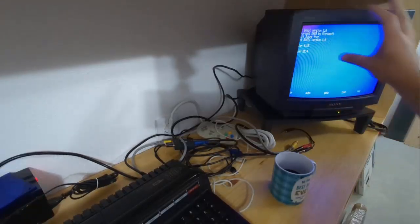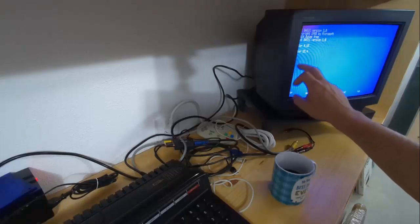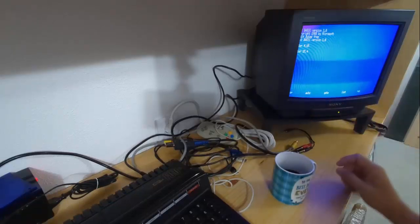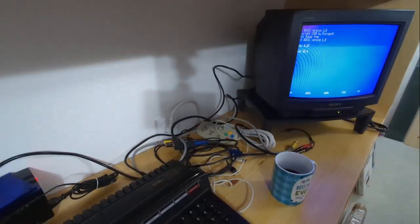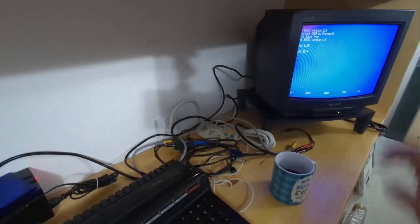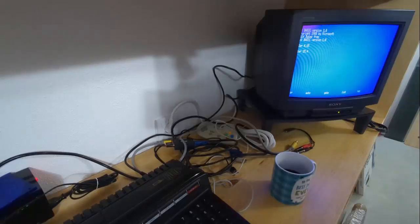I tried using magnets to see if I could clear this up — it didn't work. I still have some spots here. Not sure if it's visible on the video, but there are some spots here as well. So it's a little messy — the color on this particular screen, and also a little distorted. I looked it up on the internet trying to find a solution. This TV unfortunately doesn't have a degaussing system built into it, which means I need to do it externally.